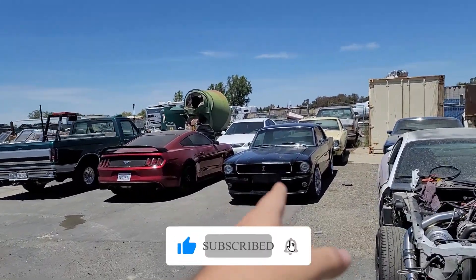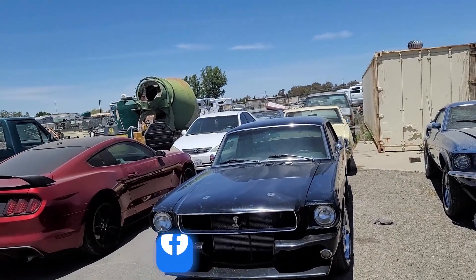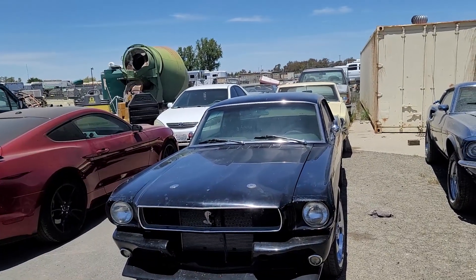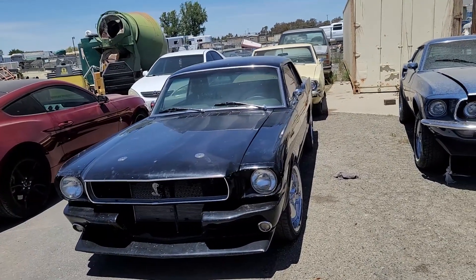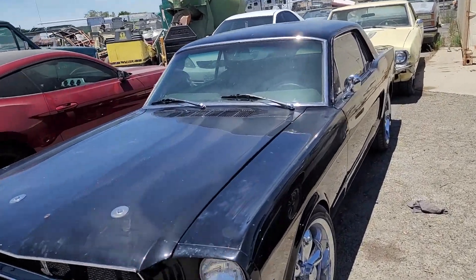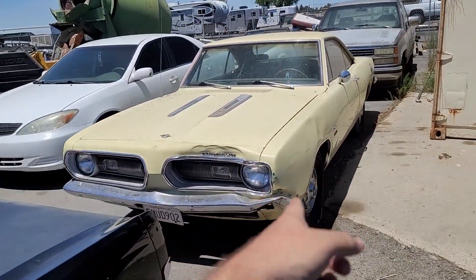The '65 — we're still waiting on a new sensor. It was supposed to be here two days ago, then yesterday, and it's still not here. As soon as we get the new wideband sensor, I can tune the car and it'll be done. It would have been done a long time ago if the wideband hadn't gone out on us.